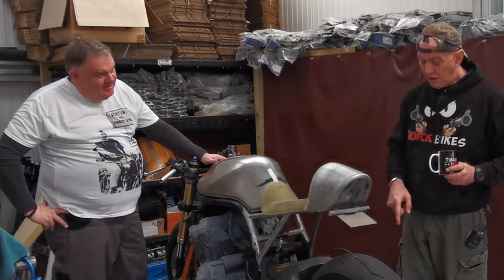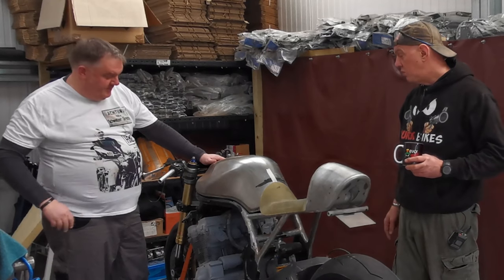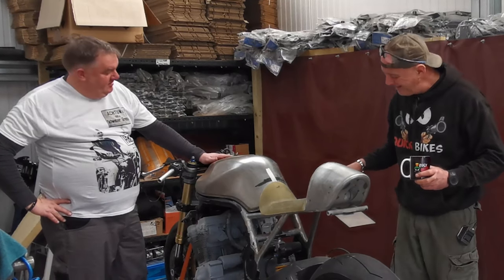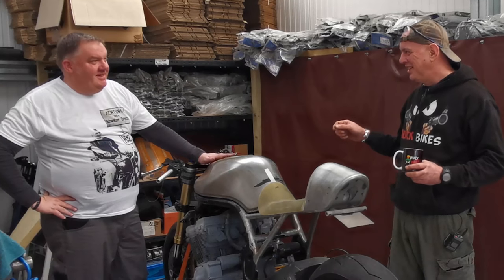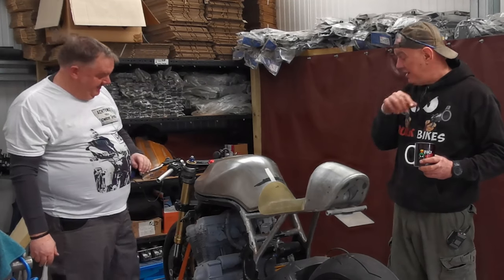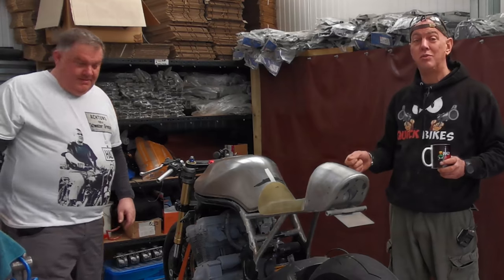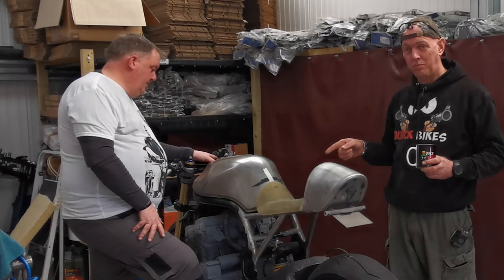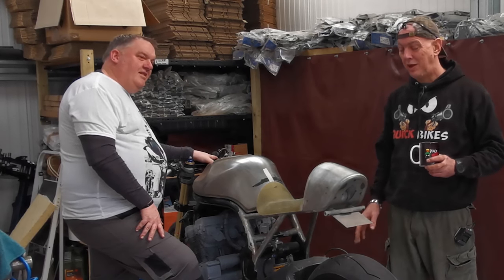Starting off with, the swing arm is 70mm longer than the standard one. I've measured it on my bike, the big bruiser that sits in the corner. This has also got a much different stance to it. This thing is doing a push up, basically. It's a bit like a bulldog, isn't it? Yeah. So, a bit like me. But the biggest difference is that the forks end to end are 70mm shorter. So it's 70mm shorter at the front, 70mm longer at the back. So the whole thing's doing a push up, and that changes the geometry massively. The rake on this is about 3 degrees off what a GSX-R1000 would be, and 2 degrees off the other way from what a Bandit would be. So nicely in the middle.